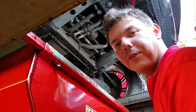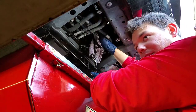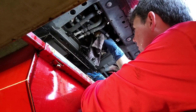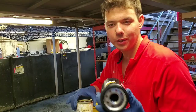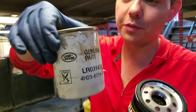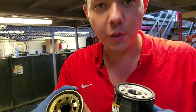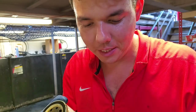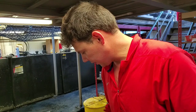Now it'll be time to prep our new oil filter. We're going to wet her up, lube her up, and slip her on. Out with our old filter — time to prep our new one. This is a Wix oil filter, good for 10,000 miles. This is an OEM genuine Range Rover Land Rover filter, and the difference is the upgraded anti-drainback valve is better on the Wix. The media filter is also a little bit better — it catches more contaminants. If you can get the AMSOIL filter, that's even better — it filters at 99% efficiency at 20 microns. This one has an efficiency rating but it's not quite as good. But this is the exact filter number we're using.